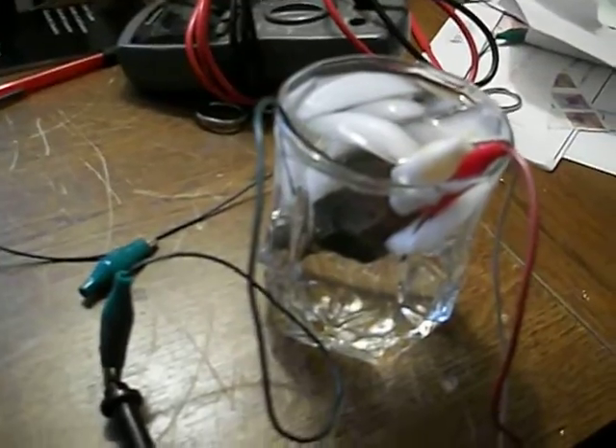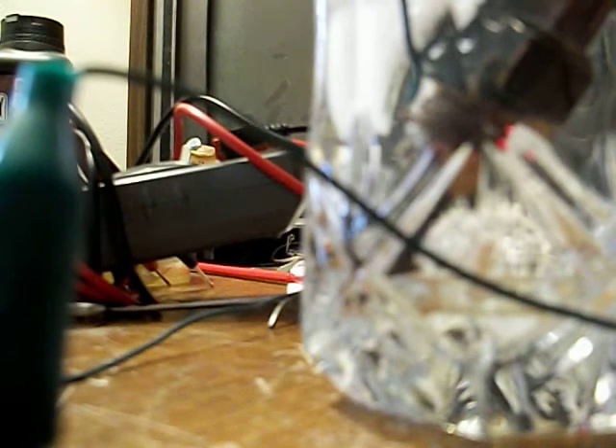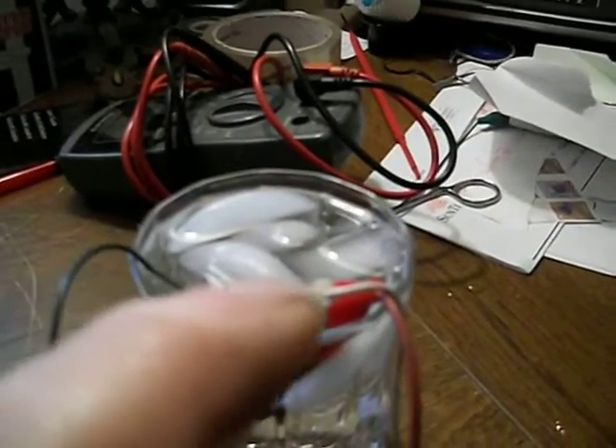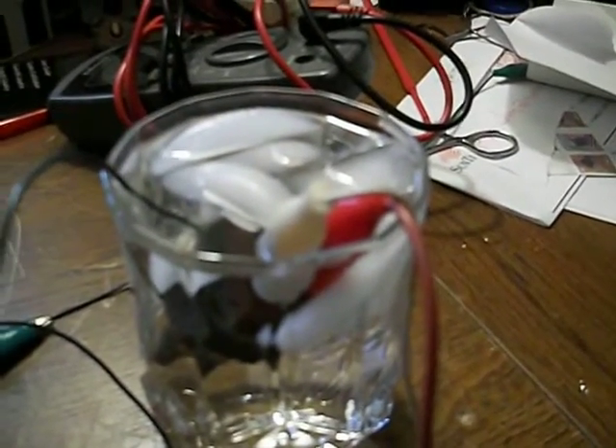The heating element will force it to open. Now we'll connect up to the other side. I'm now disconnecting the heater — now only the one connector. I had the red connector hooked up, now it's the white connector. I have confirmed I've got good continuity. This is important — make sure your test equipment works. You should be able to confirm that the cable is connected to the meter and everything works, because your test equipment can really throw you off if it's not hooked up right.